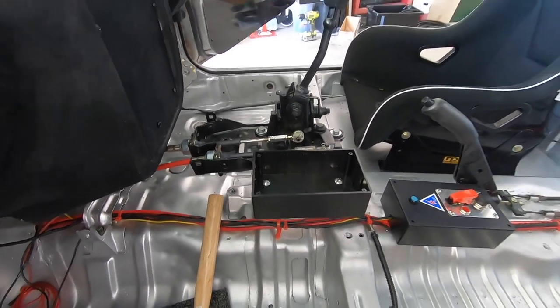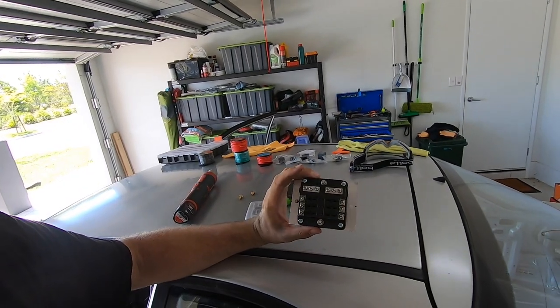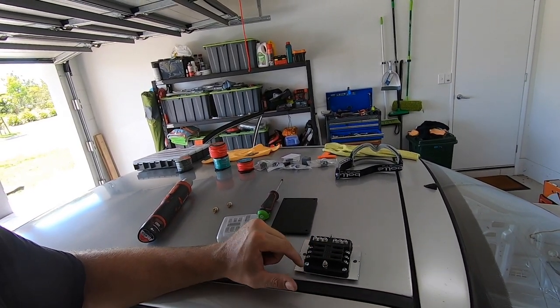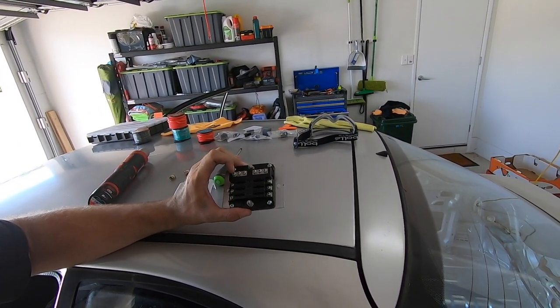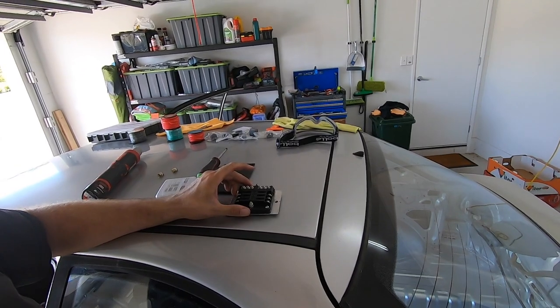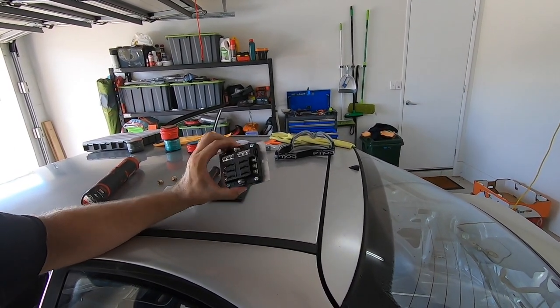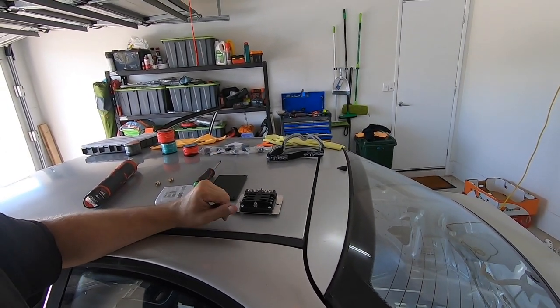Now it's time to cut the hole in the top of the box for our switches. While I was doing all that I put together our fuse block — all your positive runs through this input, through these six screws, and your negative here. These ones across the top are all your negatives, so instead of having six wires going to a ground point on the car I can run it straight to this point and run one common wire out to a ground on the chassis. Remembering our car tech battery isolator — all the ground points have to run to the chassis. I made a little plate so it fits nicely under the dash.